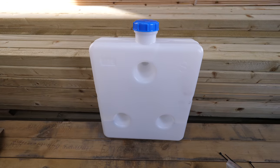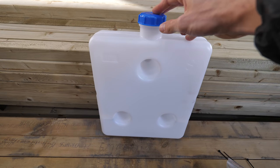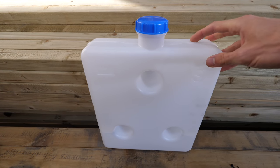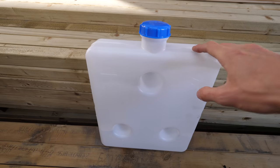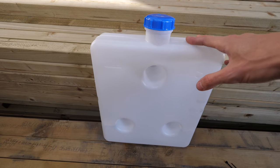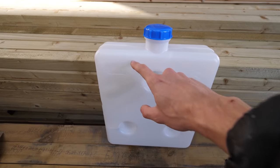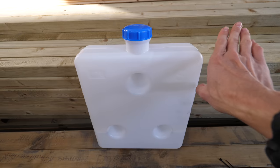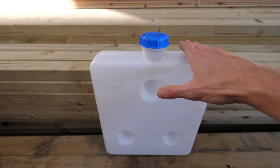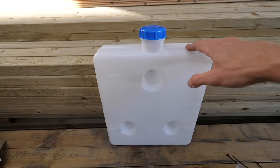My next tip is about the diesel tanks. The kit I got had the filling cap on the top — I don't think that's a very good design. You can find kits with the filling point on the corner, facing out at 45 degrees, and those are much better and easier to mount. For example, if you had a low bed and wanted to fit the tank underneath, you'd never be able to fill a top-cap tank. With the corner-point tank, you could still tuck it under a low bed and easily unscrew and fill it.